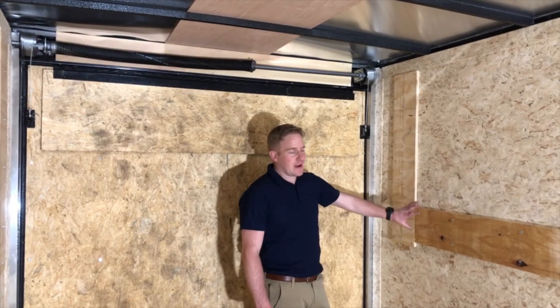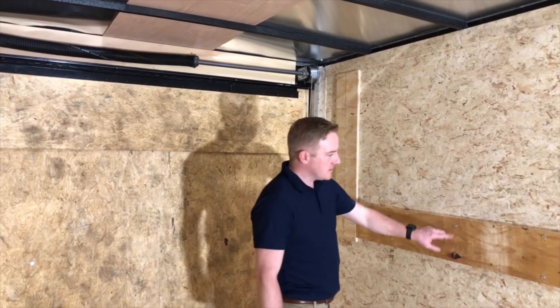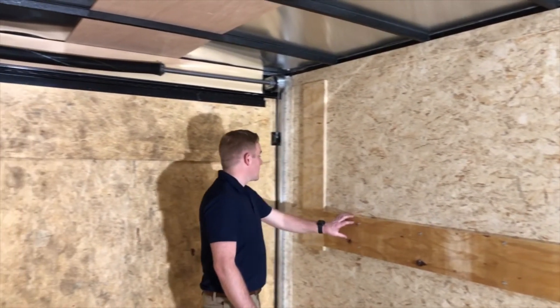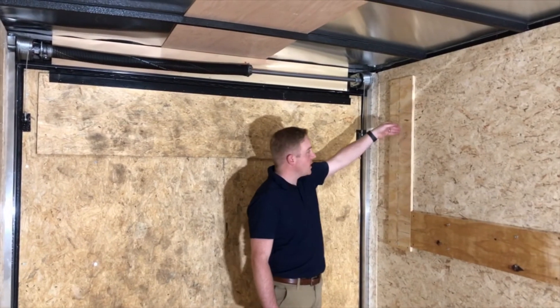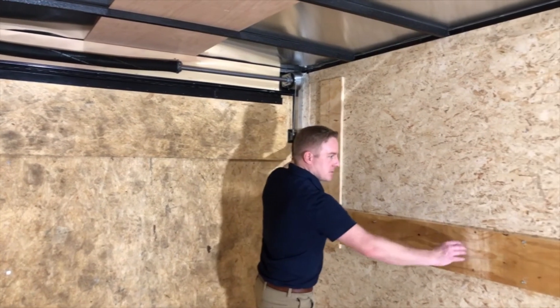You can see here we've got our backer up. We've got metal lags into the studs, over 16 on center, we glued behind it, three-quarter inch thick, ran up this stud as well. It's going to sit right back here, right down the center of this when we go to mount it into this three-quarter.